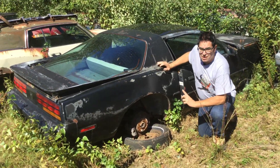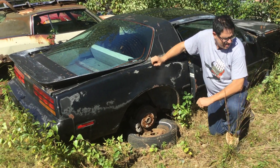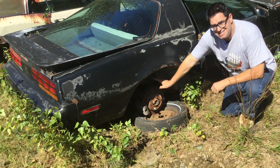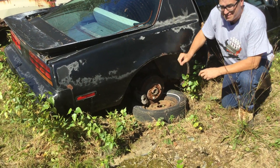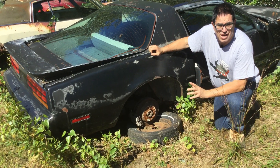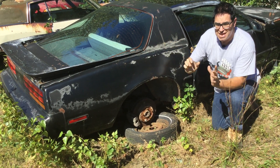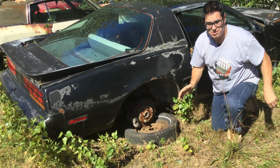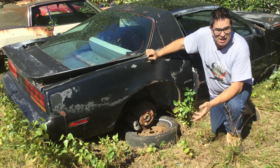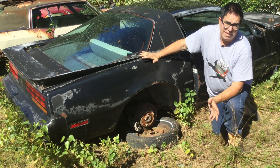Every time you see one of these you're also looking at something very special under the back of the car. This is the Borg Warner M78 rear axle. When you see the disc brake right there, this is going to have a nine-bolt inspection cover. These are Australian-built axles with a larger seven-and-three-quarter inch ring gear versus the 7.62-inch ring gear on the standard Salisbury-type axle used under a 305 Trans Am or a lesser car.